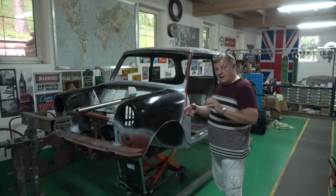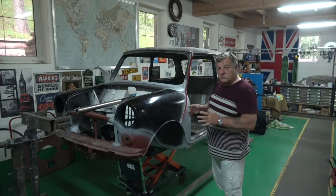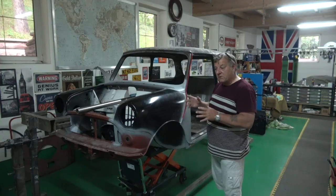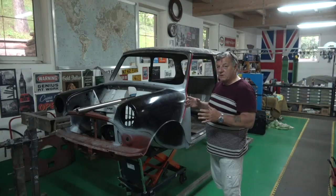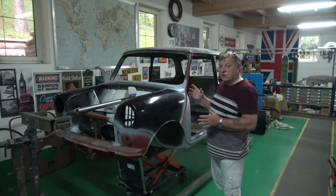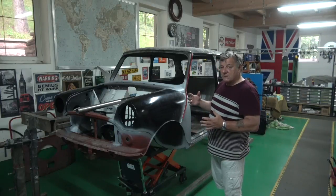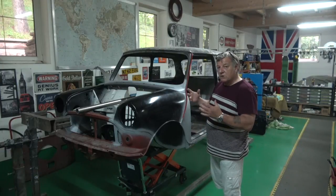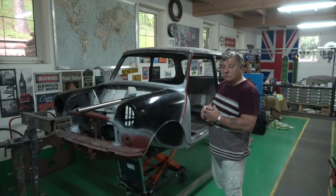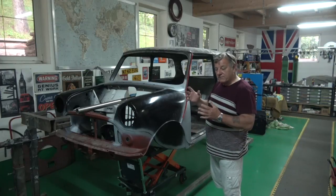You've got no strength there whatsoever. So I'm going to turn the camera off now and point out some of the points where you could secure it. You basically use the same jig - the same rotisserie - but adapt it slightly with a small amount of money: a tubular inside, which will make the complete difference. It'll stop it dropping and hanging. Sean C will put a video up on Friday showing and explaining some of these problems. I don't want to alarm anybody, but if you start cutting too much out you're going to have some problems. We've had that problem already.